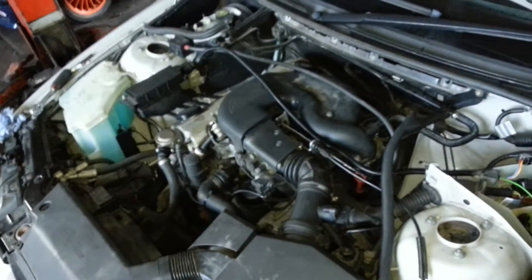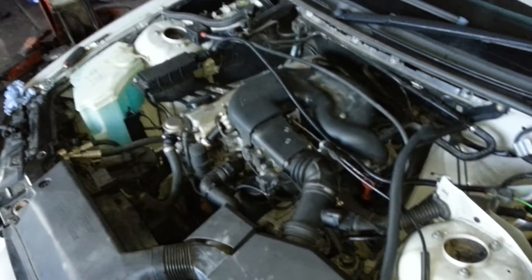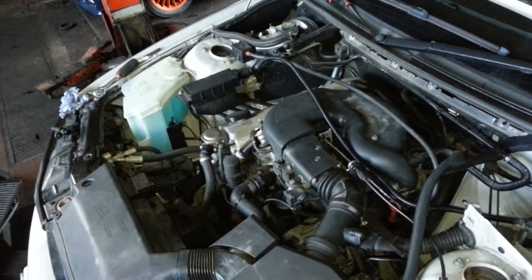You run through the process — you try fuel, you try everything else. Aim towards the ECU to start with if you have a no-spark issue on an M43 engine. Alright, thank you very much.